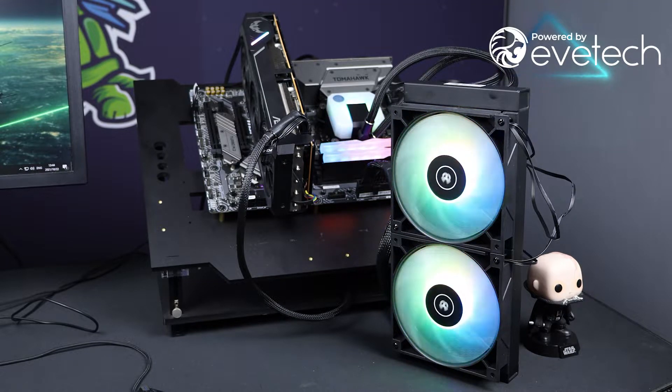This is not their premium kit — they still have their Elite series which comes with six fans for a full push-pull setup — but as their entry into the AIO market they've done an exceptionally good job. You can tell somebody actually used and installed it before shipping, which you can feel as the end user. All the mounting brackets are top quality and easy to use. Performance is exceptional, and even at full load the fans were only at 60% — so there's still headroom. The 9600KF at 4.8GHz pulls about 140W, so this is effectively a 140W thermal test.